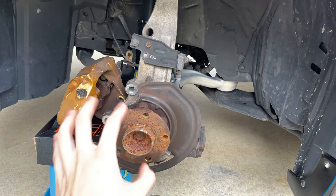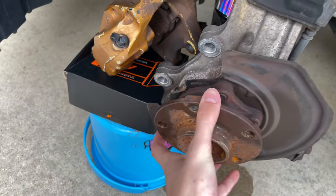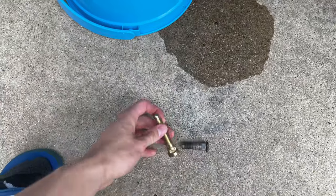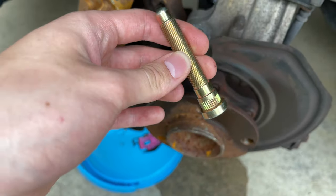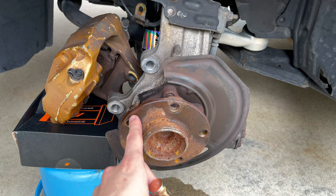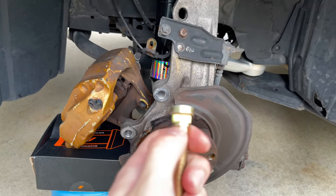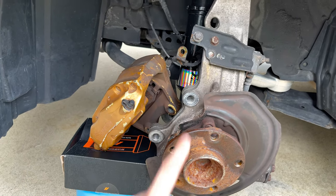It is the following week and we ran into a problem. The front hub on this car did not come on this G35 — a previous owner changed the hub with an aftermarket one. I did some research: the stock stud on a G35 or 350Z is supposed to have a 14.3mm knurl size, and I confirmed that with a digital caliper. But the 14.3mm would not seat in the stud holes at all — it would only get up to the knurl and not past the ridge.